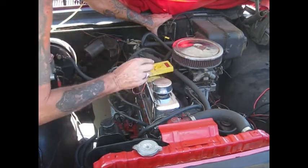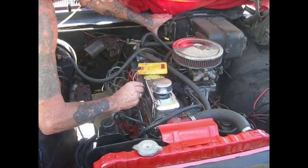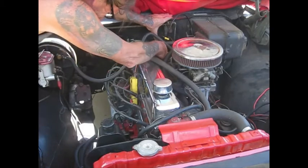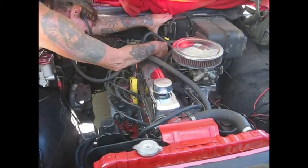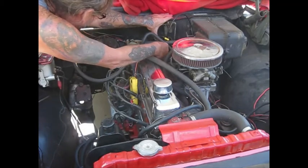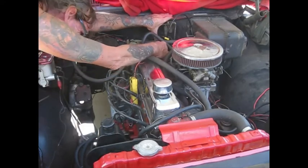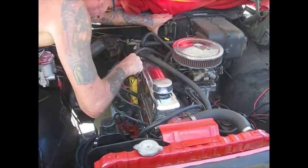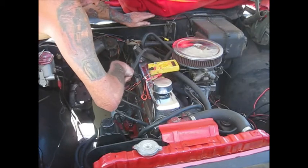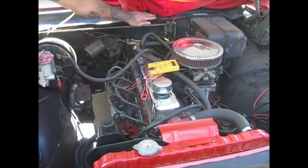Where's my negative? I'm measuring: back of one terminal — 5.8 volts there, 12 volts there, 5.8 volts there, 5.7 volts there. So what I might do is take this wire off and replace it, because it's all broken and looking pretty shabby. I'll do that and have another look.